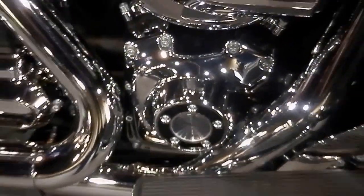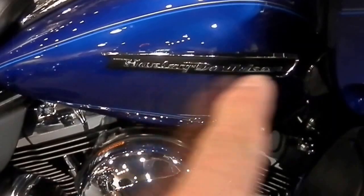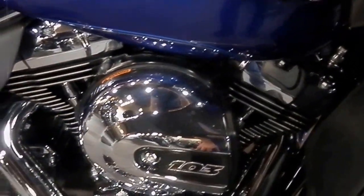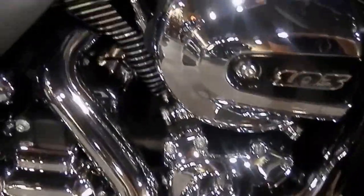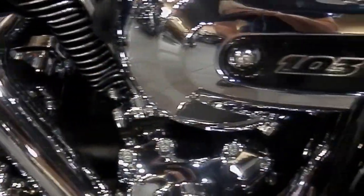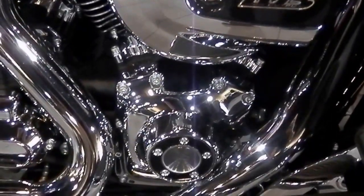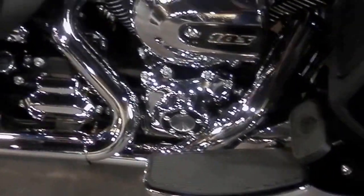In order to do that, you'd typically have to take off the gas tank — and remember this is liquid-cooled, so there's a lot of plumbing under here that all has to come off. You have to pull the rocker boxes off so you can get the push rods out from the top. Or you can go the cheap route: keep the tank on, the plumbing on, the rocker boxes on, come over here, take off the covers for the push rods, use a bolt cutter to cut all four push rods, and put in adjustable push rods. That'll save you some time and money, but you still have to take the camshafts out and replace those tensioners.